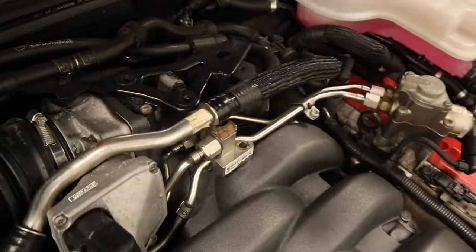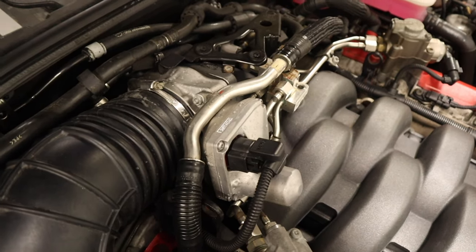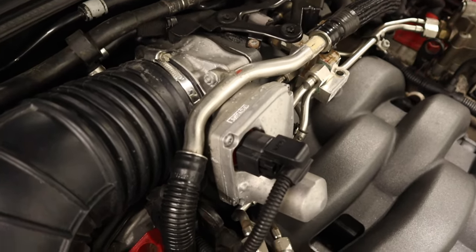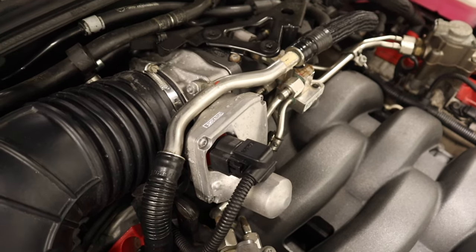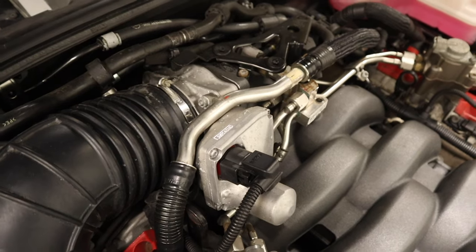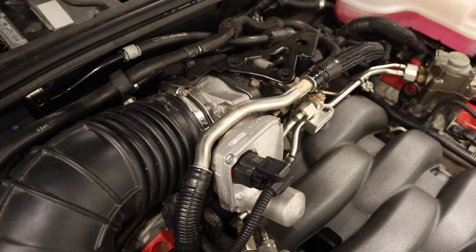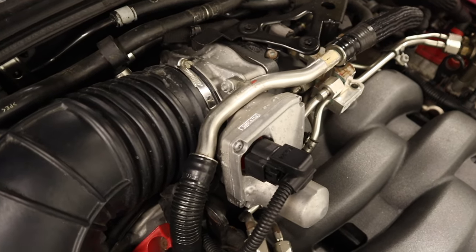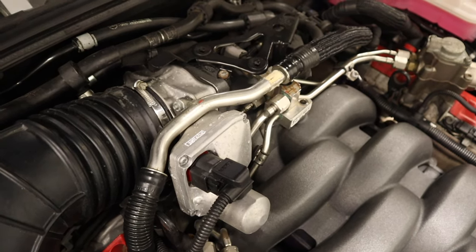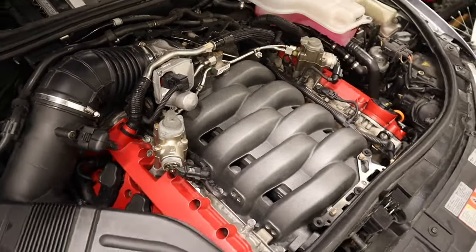When it removes the throttle body and everything — another bonus tip for those new to my channel: 4,000 RPM limp, which happens to these cars, is usually a bad throttle body — electronic throttle body. There are a few from the Corvette Z06, actually a GM part number, that you could use. Because the throttle bodies from Audi are over $2,000 US. This one is from Rock Auto, Smart Auto Products. There are a few options for throttle bodies, and it is a common fault on B7 RS4s, especially with the age they're getting.